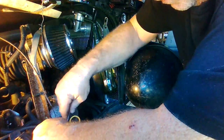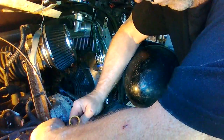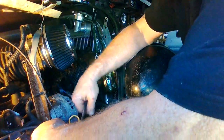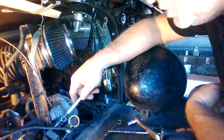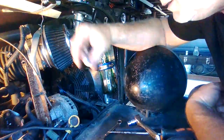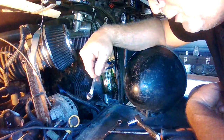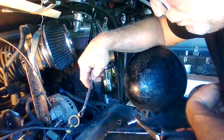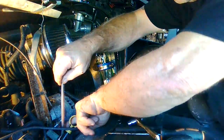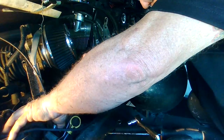Now what I do is, yeah, no wonder this was loose. Vibrated loose or what, I don't know. Maybe I never tightened it real good to begin with. I thought I did though. So now I pull out the choke, and that pulls the cable and it engages the front axle, so that works fine now. I went to put it in four-wheel drive the other day and the cable came way out, and I wondered why. Now I see why. The nut was loose on here. The bolt, whatever. Nut and bolt. Tighten that up. Oh, yeah.